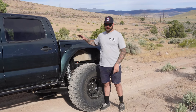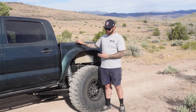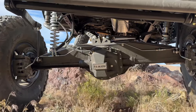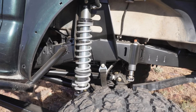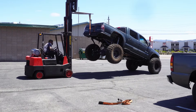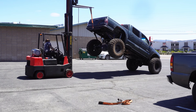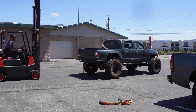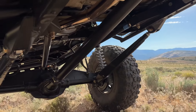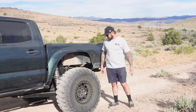We four-linked this truck on the channel — it's all done now. This is our new prototype four-link system for the Sterling axle. We've got a truss made for it, and my buddy Tyler designed some super sweet fabricated trailing arms that allow us to run a 14-inch shock under the bed. This setup gets about 18 to 19 inches of travel — bumped and strapped at 18 inches. The front's got about 11.5 to 12 inches. We have a TK1 sway bar in the back, same Fox Race Series 2.5 by 14 shock as the front, just longer, with 2.0 by 2-inch stroke bump stops. The rear end also has 5.38s from Yukon and an ARB air locker, still on the stock shafts.